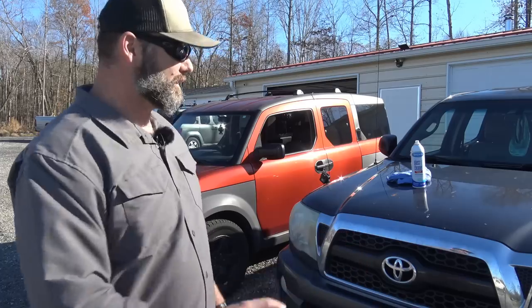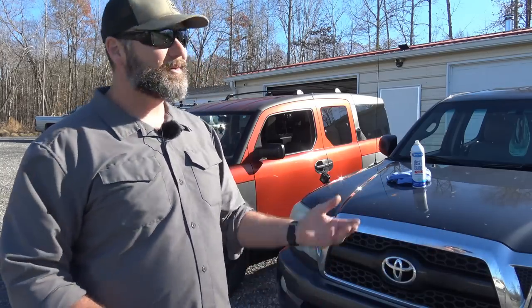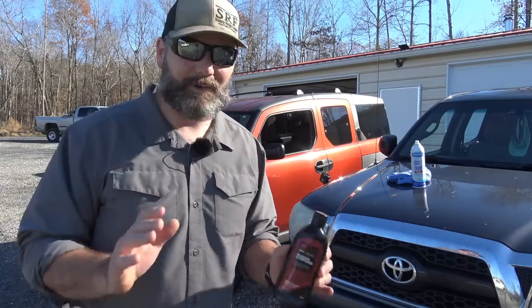There are all manner of videos on the internet with bad ways to clean your headlights — rubbing Crisco, WD-40, PB Blaster. Those are good products but they're not meant to take oxidation off your headlights. It's not about greasing your headlight down; it's about removing that oxidation. Once you do it, you'll need to revisit this about every six months. If you don't have 15 minutes every six months to make sure you can see out of your headlights, you don't have time for much.